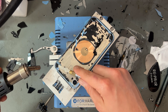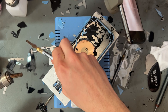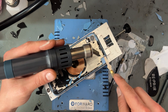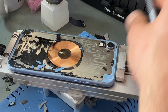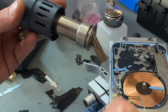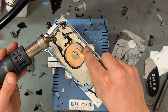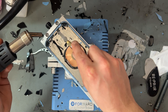You've just got to be careful on these corners because it's all plastic, so just be very light with the blade at this point because it's easy to start digging into the plastic and making a mess. If you really wanted to you could use a heat gun - I don't think a hair dryer would get warm enough but a heat gun would do it. If you fancy taking this job on yourself, I've had lots of devices where people have tried a DIY repair and given up after a few cuts or damaged something. I even had one last year where somebody had gone through the tri-star chip on an iPhone 8, so it was a mess. If you can get it off in one piece and it still feels smooth, you're doing something right. Just these last bits of glue to get off now and a little bit to tidy up on the bottom edge.